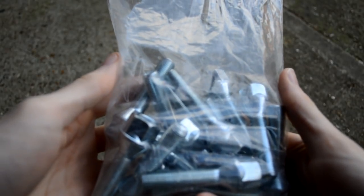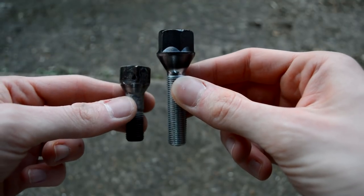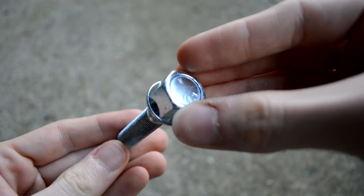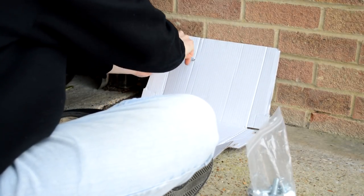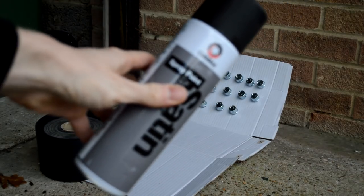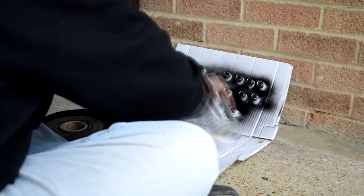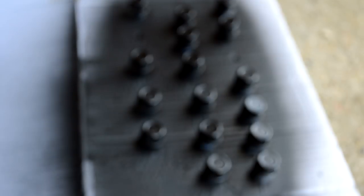I've also got 45mm M12x1.25 wheel bolts, which are far longer than the factory ones. I'm not a fan of the chrome silver heads, so the first job is to paint them a more subtle colour. I poke holes in some scrap cardboard to hold all 16 bolts and use the same satin black paint from my original wheels. The can is shaken well, a few light coats applied with 2-3 minutes between each coat and 10 minutes to dry — and we've gone from chrome to satin black.